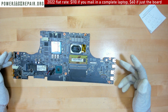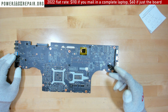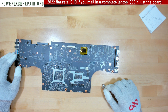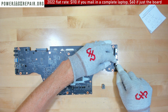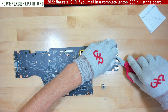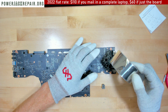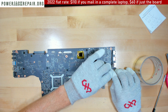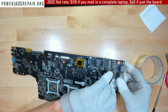It came in for the power connector repair. In some of my videos I use different types of insulation. In this case we're going to use... let me first remove this rubber piece because it's not necessary here — it's going to melt when I'm applying heat. So this is done. Here I'm going to use the 3M high-temp insulation, because there are some surface mounting components in the back that have a tendency to come off the motherboard when I apply heat.